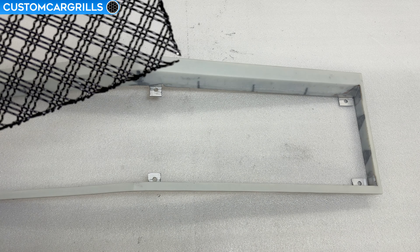Let's get this Plyo Grip out again and use it to bond the mesh to the grill. Getting this angled in just right can be quite tricky. Since I'm working with the face down, I need to make sure not to have any drip through the front. The Plyo Grip is ideal here because it's firm enough not to run, and if you get a spreader on it quick enough, you can draw it back away from the front. Let it cure and then remove the clamps. The mesh should structurally be firmly in place, but if there are any uneven spots, this might be a good time to add a little epoxy to the area and level it out.